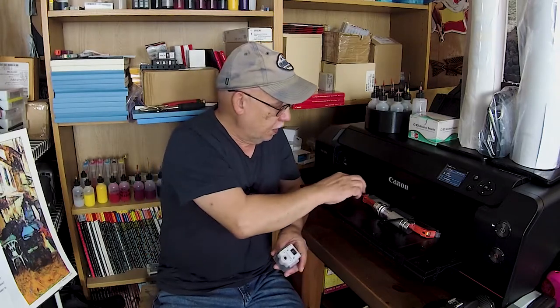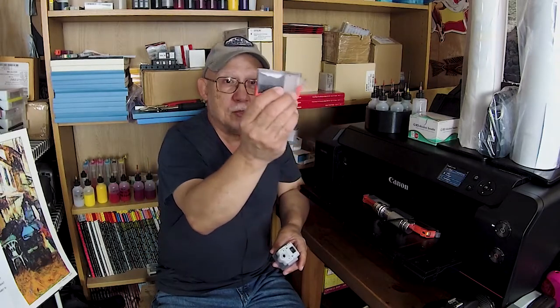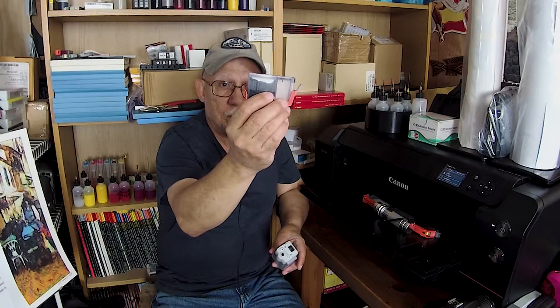It may be best to refill them when they reach low or when they're empty — it depends on the type of printer and the internal architecture of these cartridges. So the Pro 100, yeah, you fill it when it's low because you don't want to lose the saturation on the sponge. If this was allowed to go empty, this is not correct.